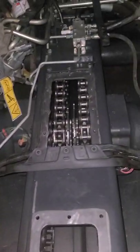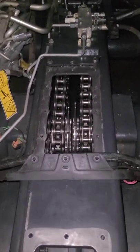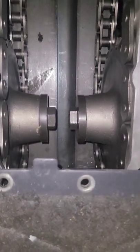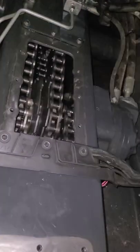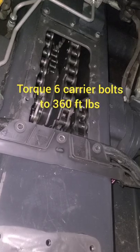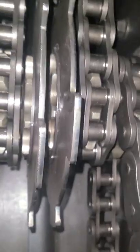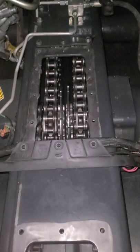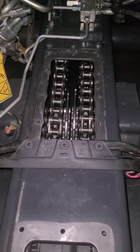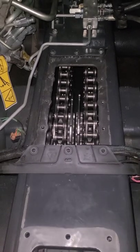I've got this thing almost back together. I didn't film a lot of the reassembly because it was a god-awful disaster. Besides the inch-and-a-half wrench and the big torque wrench to get things loose, you need a real set of snap ring pliers — I ended up having to pry them back on and it was a nightmare. If you're gonna do this, grab yourself some Aleve because your back's gonna hurt, and some prayer beads, because you're gonna need everything you can get to get these chains on.